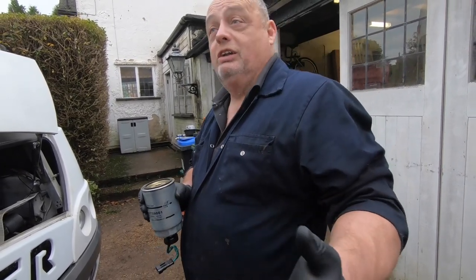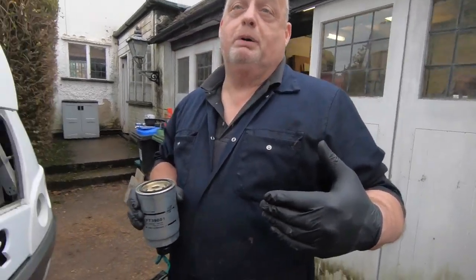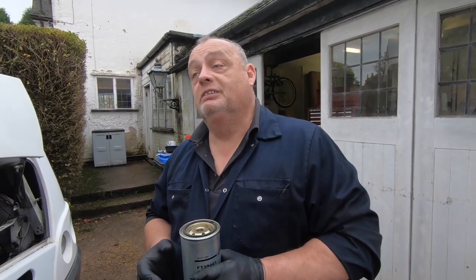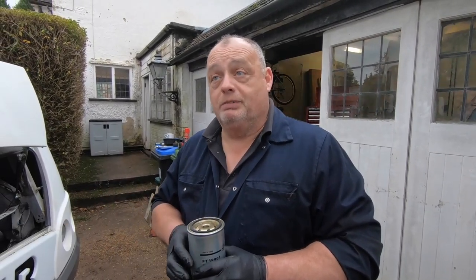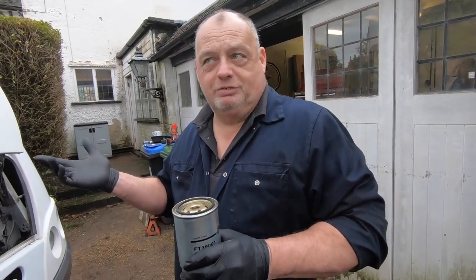Right. So now you've got to get the fuel from the tank up into the pump, and then fill this up. And then you'd be cranking over and over, bleeding and all sorts of things. Now this should be self-bleeding. Many years ago you'd have to crack the injectors or use bleed points. I've seen other videos where they've had to pump the fuel into the prime lift pump, which we're doing by just filling the filter up and priming it.